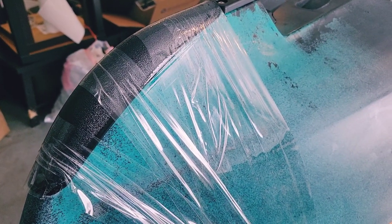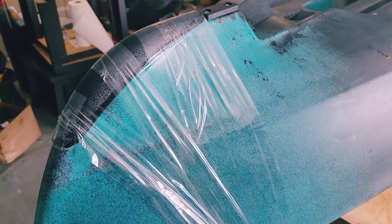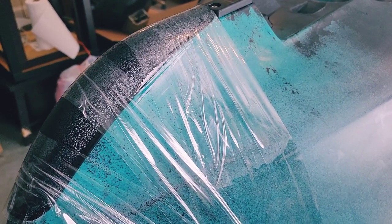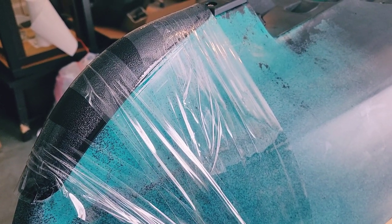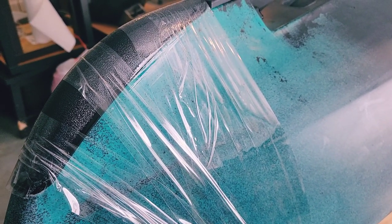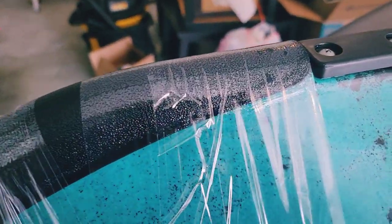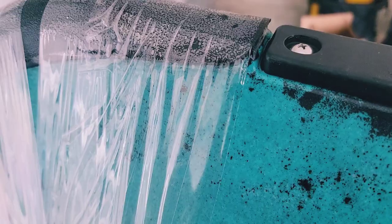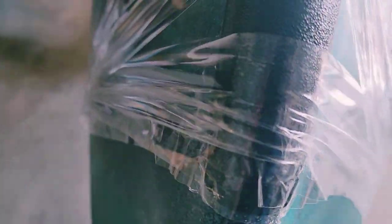So this is where we're at with our Burly Pro Bumper Bro. After letting the alcohol dry, we put down a thick layer of adhesive — I used a Gorilla Glue construction-grade adhesive; it dries clear and it's waterproof. We set that down and then set the Bumper Bro on top of the adhesive, getting it to fit roughly where we wanted it. We used a heat gun to get it to flex a little bit. You can see some of the adhesive seeping out — I used my finger to kind of round off the edges, but it didn't come out exactly the way I wanted.